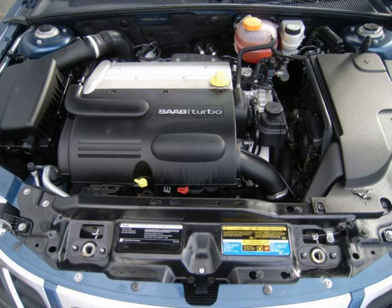The 2004–2008 Chevrolet Malibu uses a version with electronic throttle control and a special unitized exhaust manifold and catalytic converter. The Malibu and Saturn versions also use returnless fuel injection. The 2002 Saturn Vue was the first North American variant of the L61 to be equipped with electronic throttle control, whereas other applications did not arise until 2005 in the Saturn Ion and Chevrolet Cobalt. For 2007, an updated version of the L61 was introduced based on the Gen 2 design.